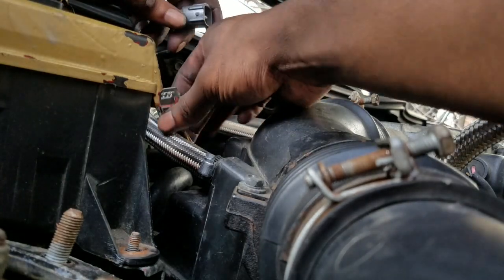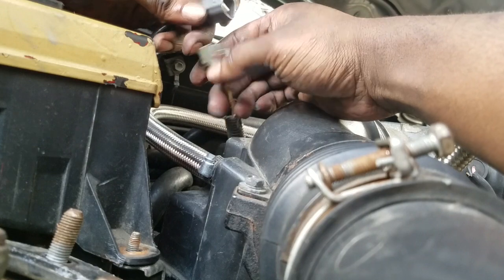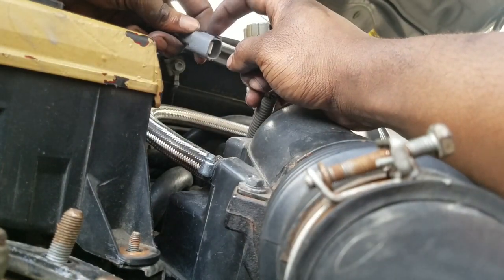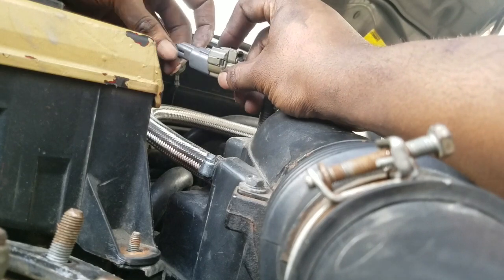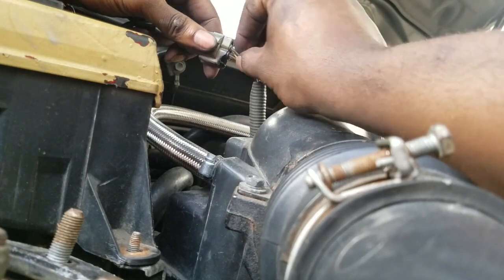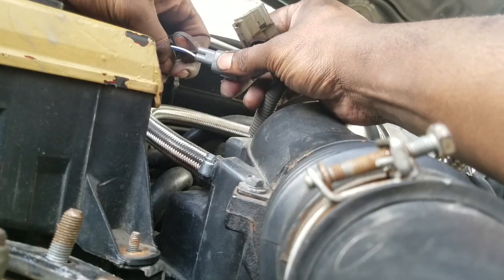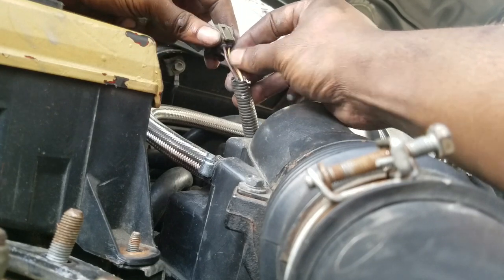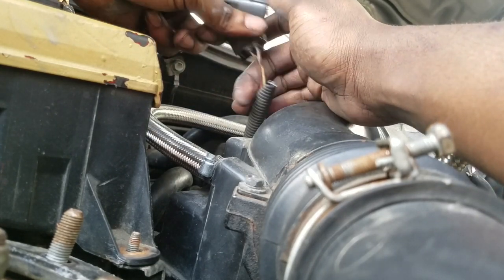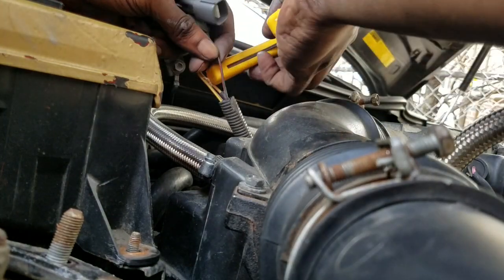Fairly simple. This is the latch, and the latch clips on to here. So all I do is take the corresponding connectors. So in the correct orientation, I take this connector, this wire, connect it to this black wire, and then take the top right wire, connect it to this black wire. So I'm gonna do it one at a time so I don't lose my place.